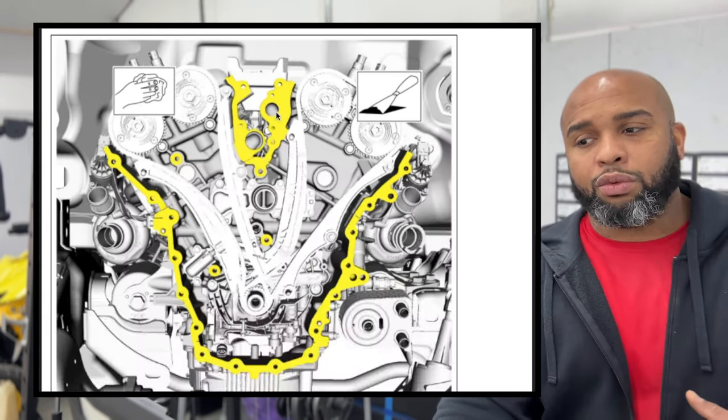So basically with the left hand or driver's side valve cover, you don't really have any complications getting it on. It's pretty easy compared to the other side because you're not having to worry about that fuel rail and the high pressure. So what you'll do is just replace your gasket as Ford recommends. You'll throw the old one in the trash, put the new one on there, which does go in a certain way, just like the other one does. You'll make sure you don't have any bulging silicone from where you closed your front cover. If you do, you'll cut that off, put a little drop of the RTV on top. Then you will be tightening these bolts down to 89 inch pounds. Once you get these bolts tightened down to 89 inch pounds, you're pretty much done with it.